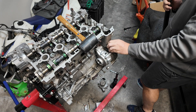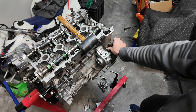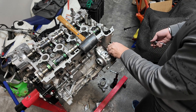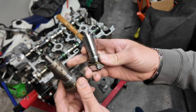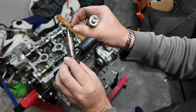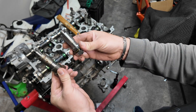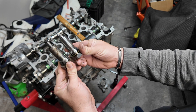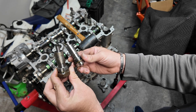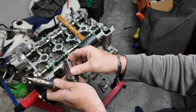I'll show you the difference here of an activated one versus a non-activated one on these tensioners. So you can see that's the one we just pulled out — that's our activated one. There's a little bit of debris in here. So: activated, that's the old one. Obviously, our new one: unactivated. Once they activate, I wouldn't say you're screwed, but you've got to take them apart and push the pin in. Pretty cool how all these activate.